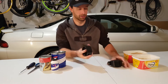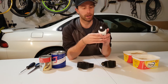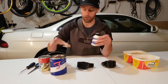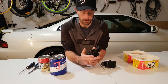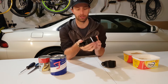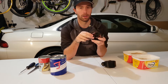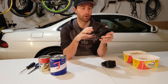What I've done is decided to do this properly and I ordered from a mob in America — it's a suspension company and they do this full polymer bush kit. So basically you can make your own polyurethane bushes, which is really cool. I've got the mounts out of the XL; they are heaps floppy and really gross — just really junky rubber. For road cars it's really good because it soaks up all the vibrations from the engine so you don't get that in the cabin, but for a race car it's no good.